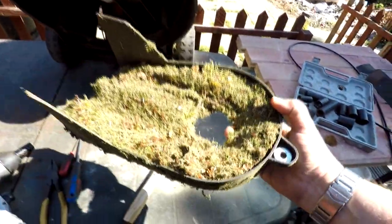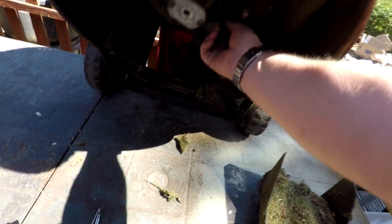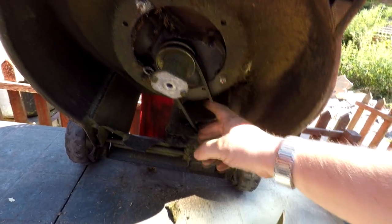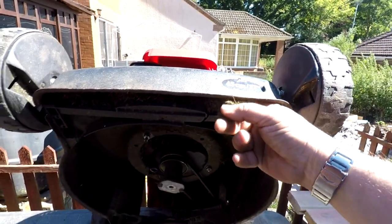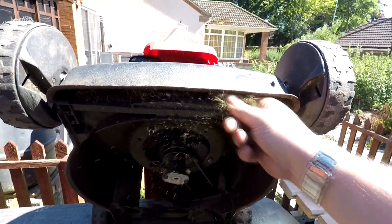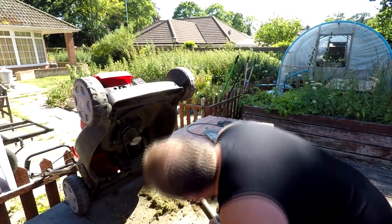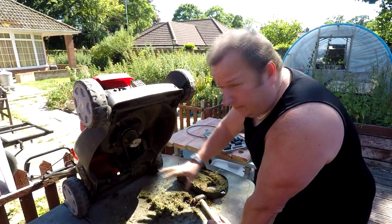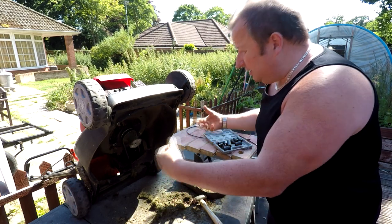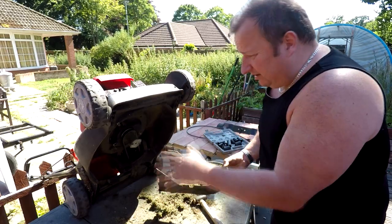What you get with these when they've not been maintained for a long time is that it's full of grass cuttings, and that in turn can cause the belt to drag and cause issues. The belt actually looks in good nick and there looks like a pretty new boss on there as well, so I'm quite happy with that. People don't clean their mowers out correctly — it's absolutely crammed with grass cuttings at the front as well, and you might find a collection around the motor too. That's obviously one of the signs that possibly caused the issue with the wheels — it puts more tension on the belt. We're just going to get rid of all this, have a clean up.